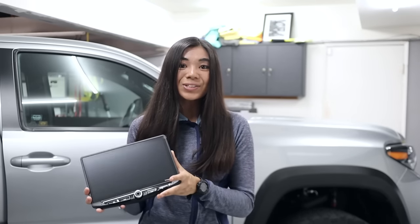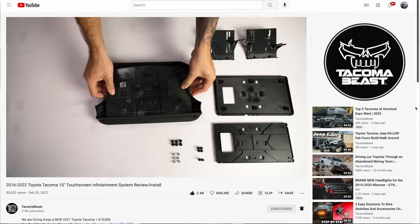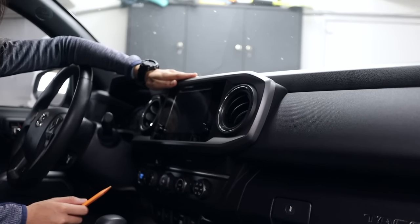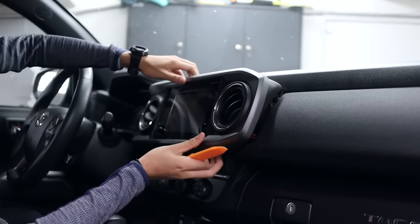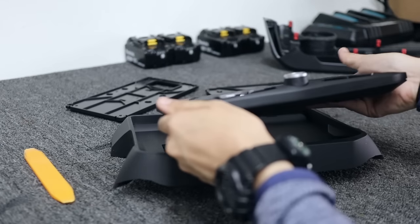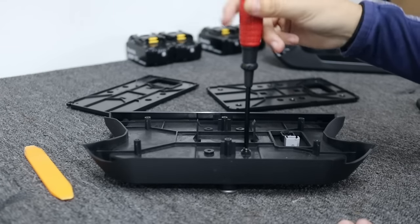Installing this head unit is actually not too difficult because it's all plug and play, but there are a lot of parts and pieces so it can get confusing. If you need extra help, check out the TacomaBeast channel — he has a great, clear, easy-to-follow video installing the exact same head unit, linked in the description. Step one is to remove the center dash cover using a plastic pry tool — work your way around under it, you'll hear it pop, and the whole piece comes out. Then over at the workbench, take the Hi-10 screen, place it in its mount, carefully flip it over, and install the four screws from the kit to secure the screen.